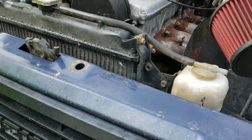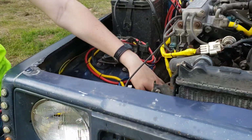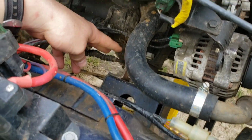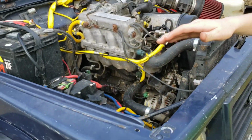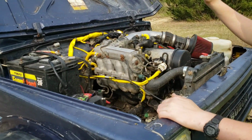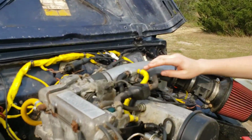And then another issue is the motor mounts, the stock 1.6 motor mounts down here. So what we have is a Dodge 318, I believe, motor mounts. They're meant for a V8, and those work pretty good at dropping the motor and being able to rotate it side to side in the car. But you still have some clearancing issues on your hood, because we learned that the hard way.